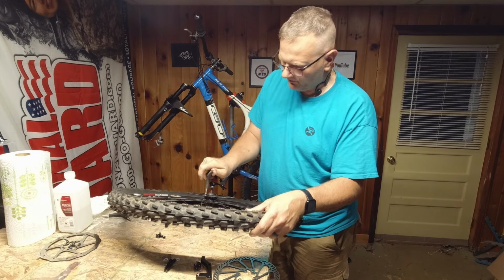And these bolts come pre-treated with blue Loctite on them because you don't want them coming back loose. So once you run them in, Loctite will hold them in. It's already dried to the threads. So at that point, it's kind of like a binding agent. You're not putting it on wet.